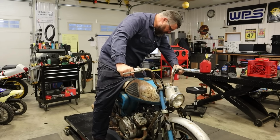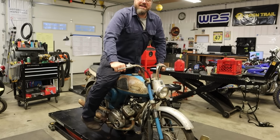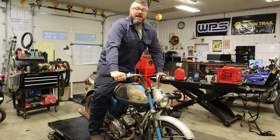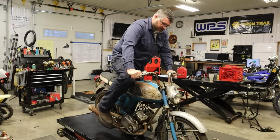Okay, we got a light in the middle. We are in neutral. We have spark, we have fresh spark plugs, we have clean carburetors, we have, how many kicks? How many did you say, four? Four kicks, and we're gonna see some life. Let's see what happens.